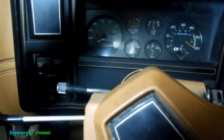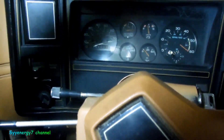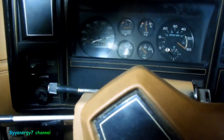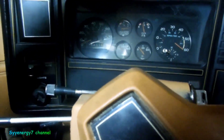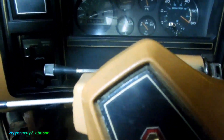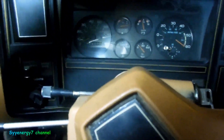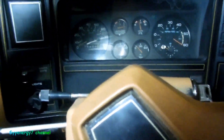So just to recap: 85 ohms is 220 degrees, 600 ohms is 100 degrees. If I put around 200 ohms of resistance I should be halfway between 100 and 220, and if I go down to around 30 ohms it should read near max. I tried it at infinite resistance too just to confirm — still no response from the gauge. Sometimes this troubleshooting is easy, sometimes it takes a while.